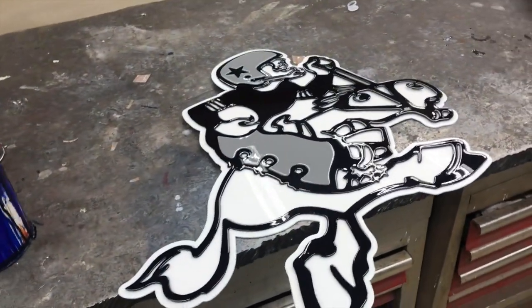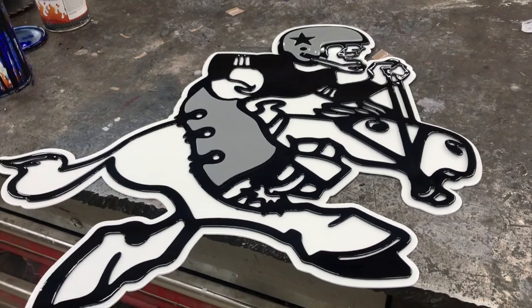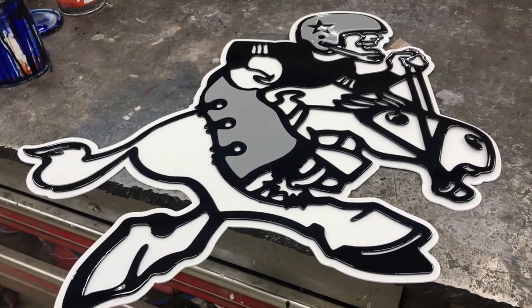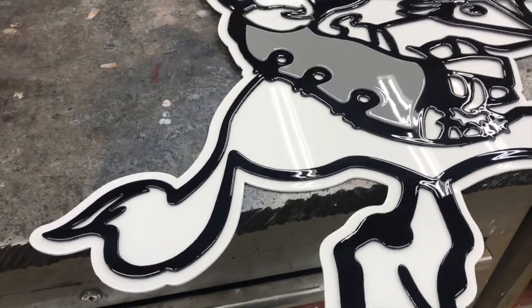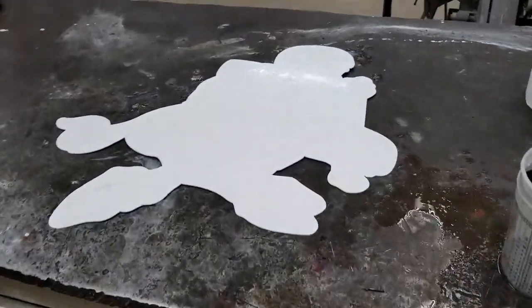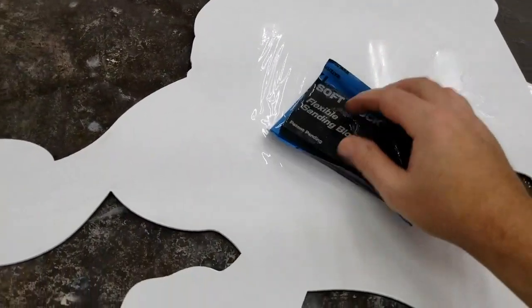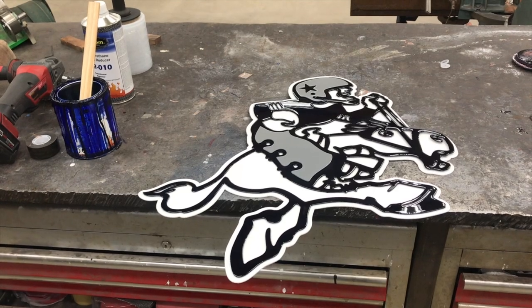I make automotive paint training videos on my website. Seeing Austin Lanier's post on the Facebook group about paint jobs reminded me that I never talked about painting in the wintertime. This is one of the first paint jobs I did this winter when it started to get cold. You can see shining it over the light it looks pretty nice, but it didn't start out that way. The first attempt came out terrible and unacceptable, so I had to wet sand the whole thing down with 800 grit and re-clear coat it.